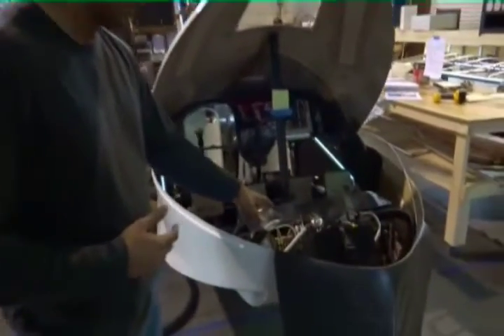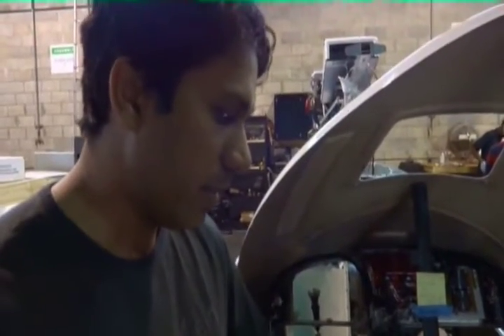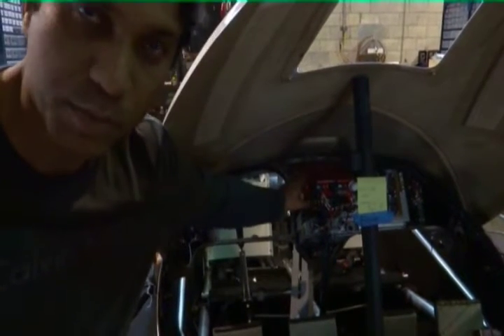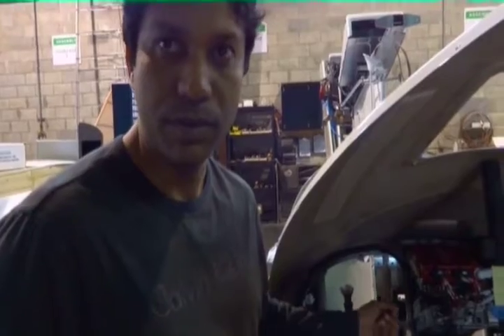Many of the connectors are water-sealed or water-resistant. If you open the hatch and drop a tool, it will not hit anything electrically hot easily. We have a nice cabin heater on the Elite model — it's not carbon monoxide risk because it uses hot coolant and electrically pushes the air out toward your feet. On the Elite model we are using the VPX vertical power, controlled by the EFIS interface, for circuit protection and voltage surge protection. On the 912 Sport model, it's done by old-school circuit breakers.